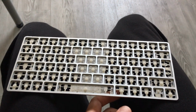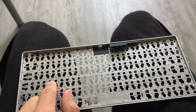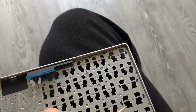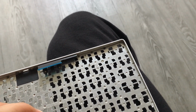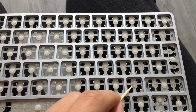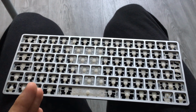So, just because I'm very upset, I'm gonna try to fix this. How? I'm gonna drill holes with my vertical driller everywhere. Although I must say, this part, it's already, you see? It's not properly welded. So I'm gonna drill holes, and it's gonna take a lot of time. I don't really have to drill a lot, and I will try to remove this layer, see what's below, and I will try to redo these lanes here with a conductive marker. I don't know what's waiting for me, but I think I'm gonna try and do my best to finish this.